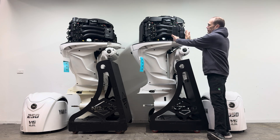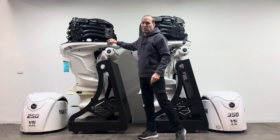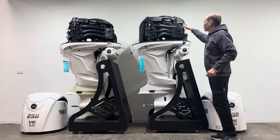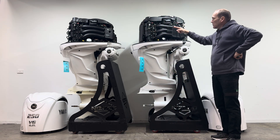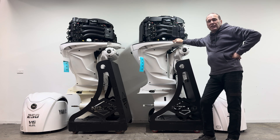You'll also notice the plenum volume is a lot bigger on the 4.3 than it is on the 4.2. They also run a larger throttle body and a different air intake compared to the 4.2. But that's just the changes that we immediately see on the outside.